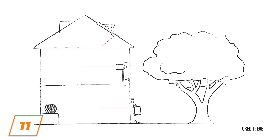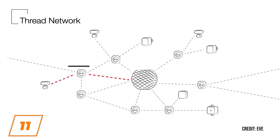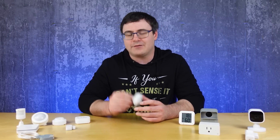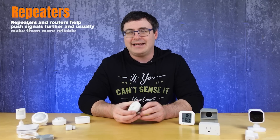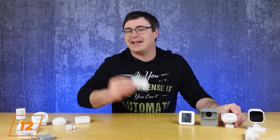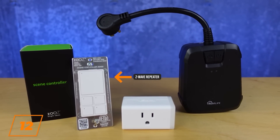Your third option is to add a repeater in Zigbee or Z-Wave networks, or additional border routers to a Thread network. With Wi-Fi, you could create a mesh Wi-Fi network as well. Your sensor won't be a repeater in most cases, because providing that function takes power, which is limited on a battery-based sensor. Instead, you will probably want a smart plug or a smart light switch that is stated to be a repeater or router for your mesh network.